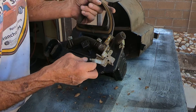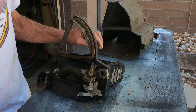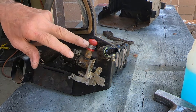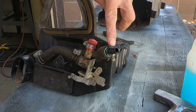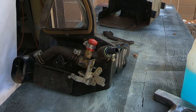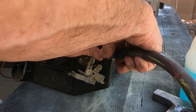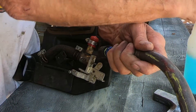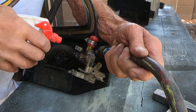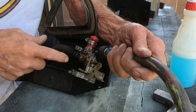If it's just a valve, I could have changed that out without pulling all this out - but that's okay, I wanted to get that center console stuff out of there to work on it anyway. What I've got here: I put a cap on here and I've got an air fitting quick disconnect tied in here, with the compressor regulator dialed down to about 7 psi. I'm going to hook this on and spray a little soapy water around here. Look at that - see those bubbles all over the place? So it's leaking right around this temperature control valve.